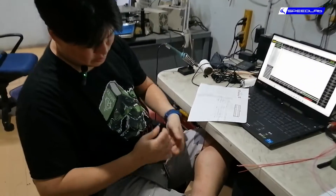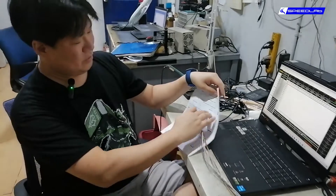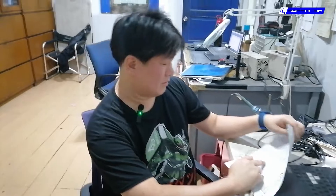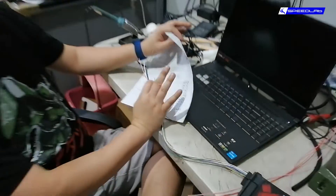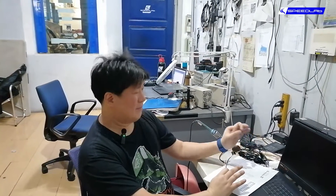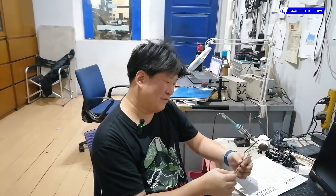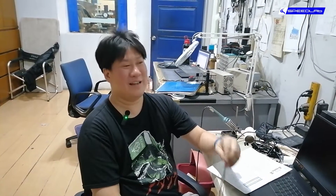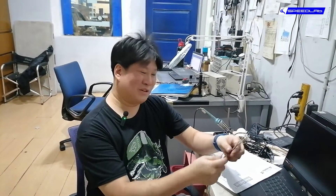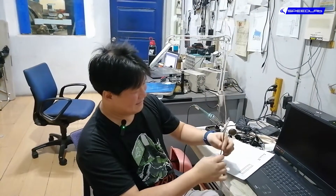This simply plugs into the Unichip, and these wires are wired into the corresponding colors for the ECU — white, black, black-white, green, and so on. The ECU wires are also essentially unique; there may be multiple black wires, but one is fat and one is thin, so they're not the same. For those afraid of electronics: if you wire the Unichip wrong into the ECU, it will not make the ECU explode, will not damage the ECU, and will not damage the Unichip. The car simply won't start, meaning you did something wrong. A signal just goes somewhere it's not supposed to — it won't fry anything.